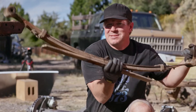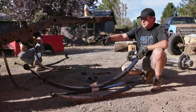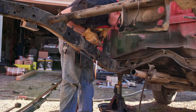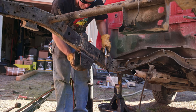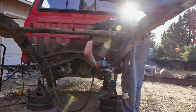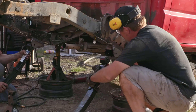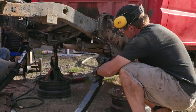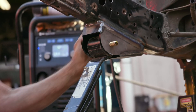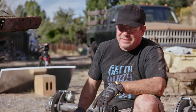This is the stock Mazda rear leaf spring. This is the leaf spring we're going to put on the Mazda — it's a Chevy five-inch lift leaf spring, and it's much longer than the stock one. Dave's going to cut off the spring hangers in the front and the shackle hanger in the rear. We have new leaf spring hangers that'll mount to the front, probably right behind the cab mount, and then come back to a shackle. It'll be spring-under, which will help fight axle wrap. It gives you a little less ground clearance, but on 40-inch tires we shouldn't have an issue. Same setup we did on the Toyota — it works pretty good and should work great on Dave's little truck.